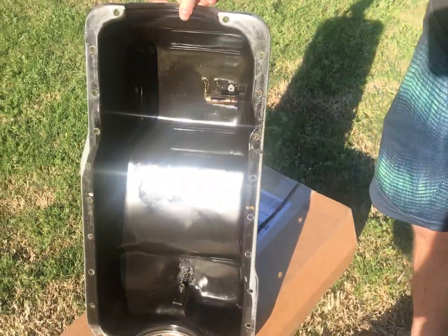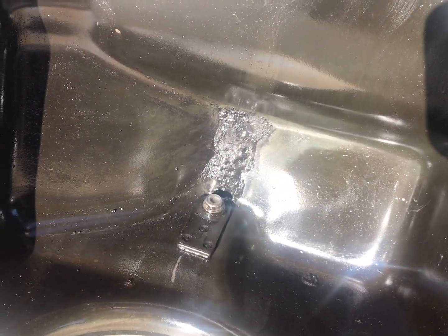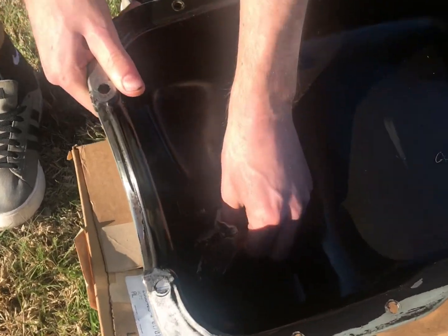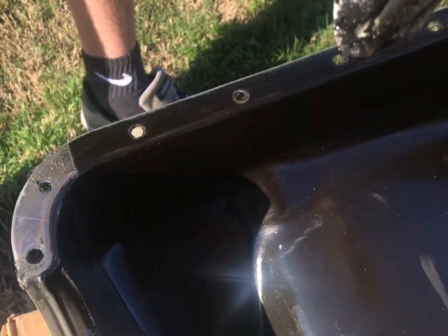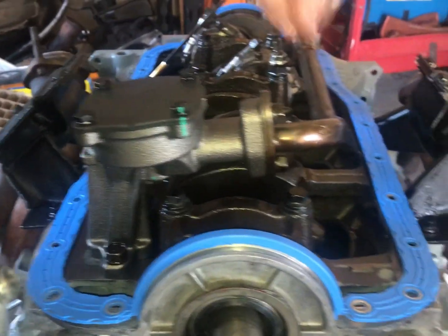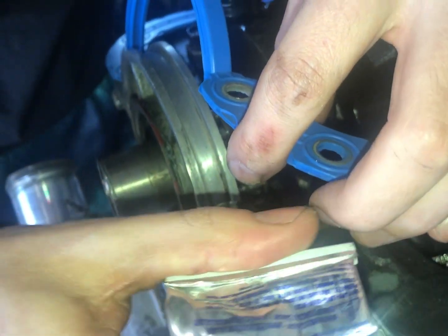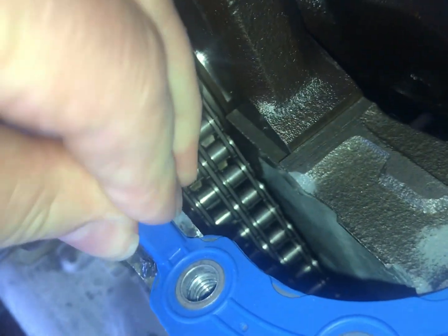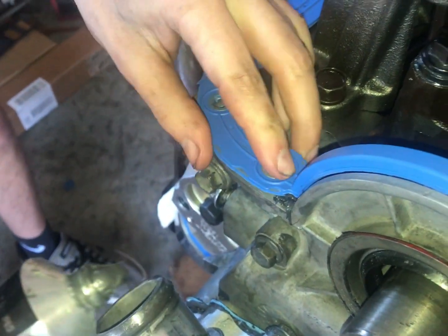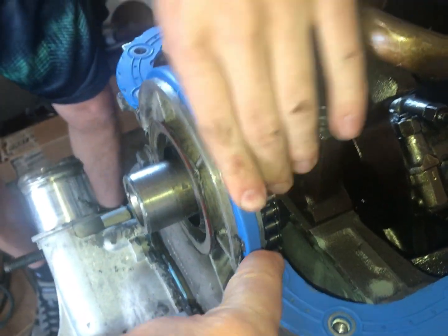One of the last things we're doing - we're cleaning out our oil pan, and believe it or not, there actually was a little sludge down in the pan. It was just in one spot there, everything else was pretty clean. Austin's just going to put a little pea-sized blob in the corners. We've got one of these really nice composite one-piece steel core silicone gaskets. He's going to smooth each one on - we're going to hit all four corners just because that's what the instructions say to do, and then put a little dab on each corner on top before we drop the pan on.